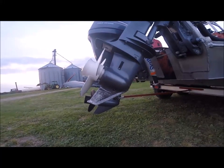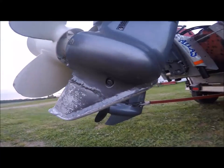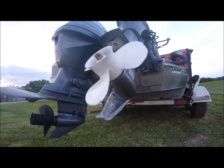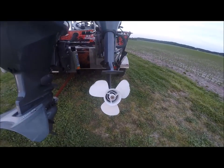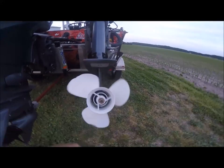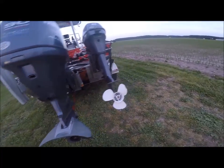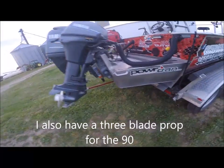Being a kicker motor taking some abuse as a bow fishing boat, one of the things I did right away was I built this up — I welded on a bead here and it's got an extra stiff skeg to it. I believe I have four props that will go with the boat. This one's in okay shape, not great. I've got one four-blade that's brand new, another three-blade that's almost brand new, and two three-blades that have been used.